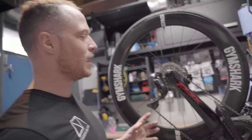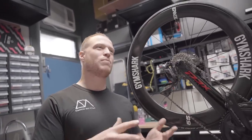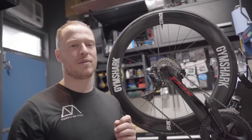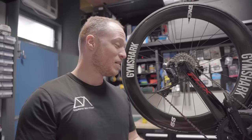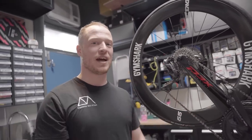The best thing really, if you want to look after your bike, as we've gone through, is to degrease the chain after most rides. Next, you just put a nice dry lube on it. Shifting is going to be far better, and the likelihood of premature wear on the chain is going to be reduced massively. You're going to be saving, as we've said, maybe 10 watts between a really well-running chain and a really crappy orange chain.